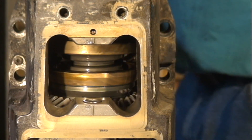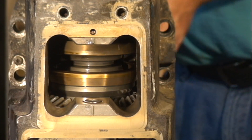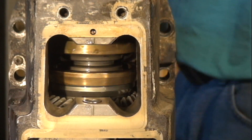You have to remove the covers from the driveshaft housing in order to line up the timing marks when reinstalling the U-joint assembly. You might as well replace the shift shaft seal and bushing at the same time, and then you will have resealed the whole upper unit.